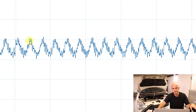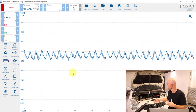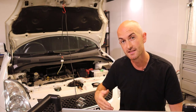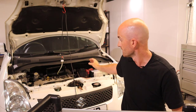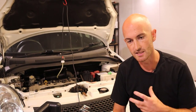What we're basically looking at here is the pulses from the intake system. On things like eight-valve engines where you get sticking valves or valves not opening, you would actually get a gap in that waveform. You can also use the pulse sensor in the exhaust system for checking the exhaust valve train side, and also inside the expansion tank and crankcase for checking other kinds of mechanical failures.